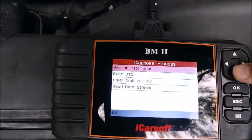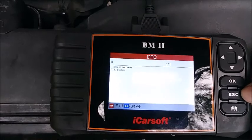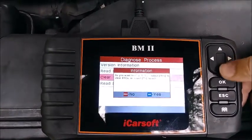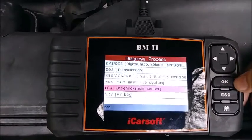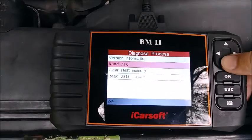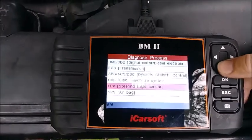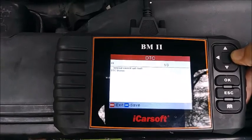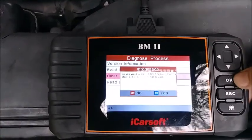Checking the security alarm — power-on reset, zero faults, clearing that. Steering angle sensor — checking it, clearing it. We've already dealt with the airbag codes — these never go away because I need to take that door off one of these days. Internal control unit, side airbag front right, and power supply issues. Clearing fault memory won't do any good there, but while I'm in here I'll do it anyway.